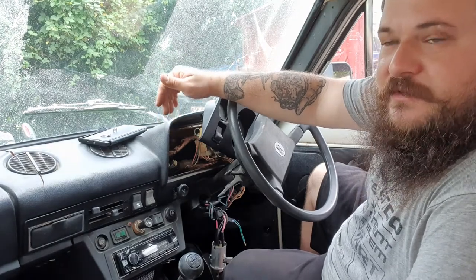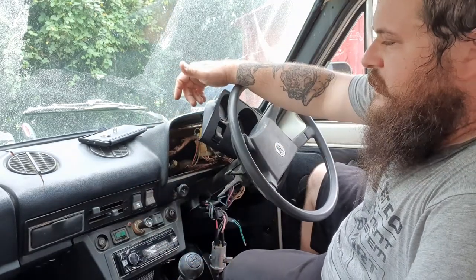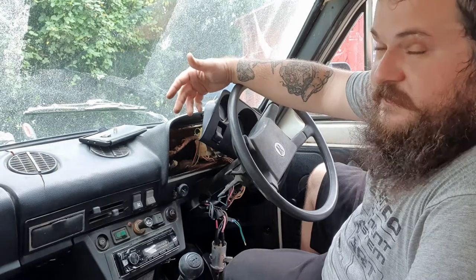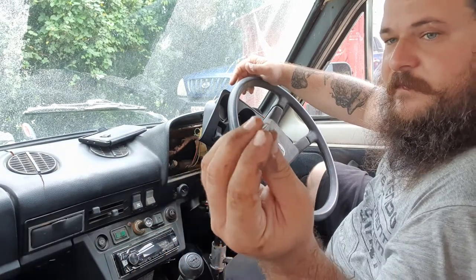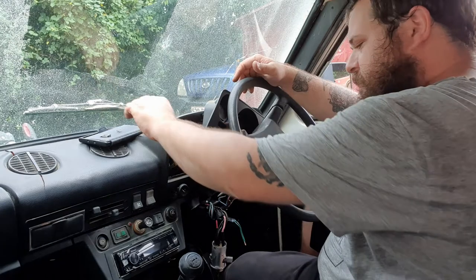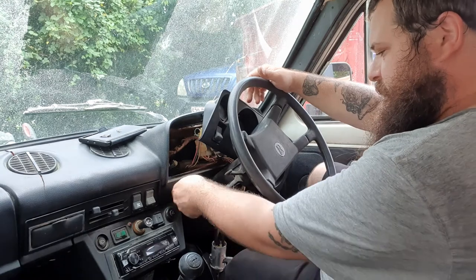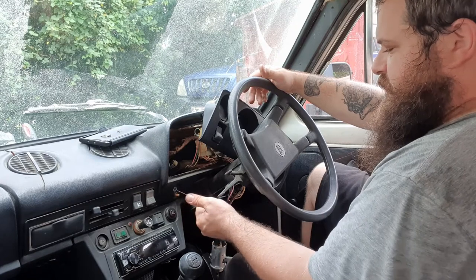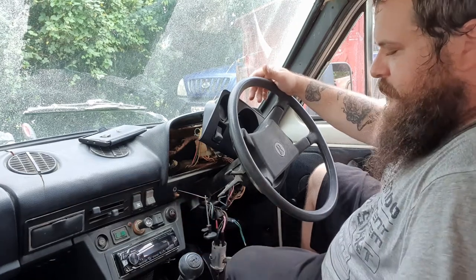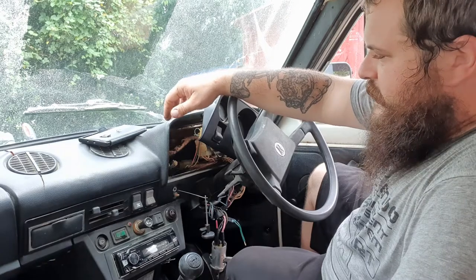now we have to cut the cable to the right length because it's way too long. I assume it's too long for left-hand drive because it'll be over there and run a little bit longer. It's probably just longer so you can do things like this. There's this little clip on the back of the cable, and that just stops it coming out any further than it needs to be. So pull that out and then you can pull this cable out. What you want to do is get a good amount extra. You can never have too much length. So why, you might ask, we'll go to the engine bay and we'll have a look.